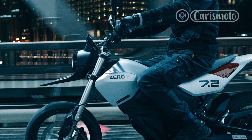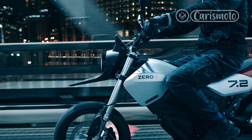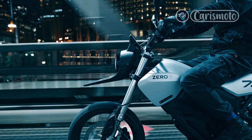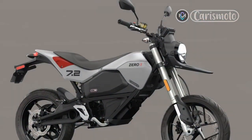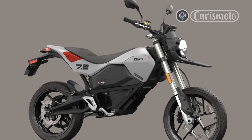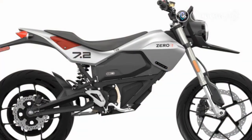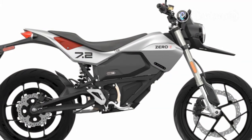The system has preset Eco and Sport ride modes, and a custom mode that can be programmed via the ZERO smartphone app. We didn't get the chance to try custom, but would have liked the opportunity to dial up maximum regen, both for additional engine braking on corner entry and because, with a relatively small battery, using the motor as a generator when you slow down makes sense, and watts.